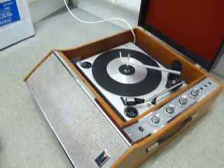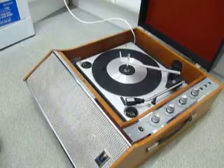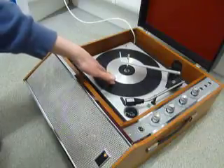This is a demonstration video of the Ultra Record Player. I'm going to show you how to use it so that you'll be familiar with it when you receive it. When you receive it, the first thing to do is to screw down the two transit screws of the deck, located here and here. You screw those all the way down fully clockwise so the deck floats on its springs.